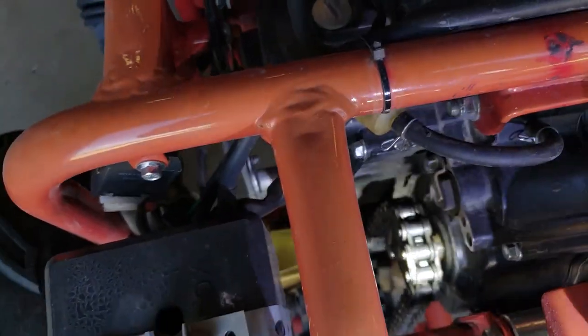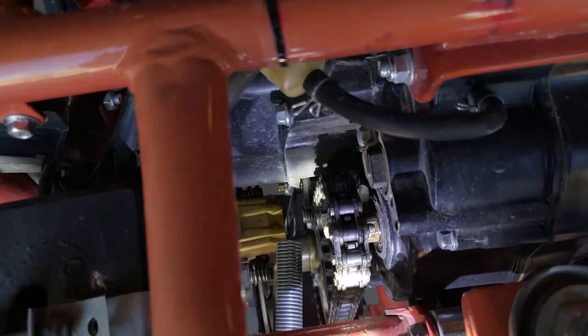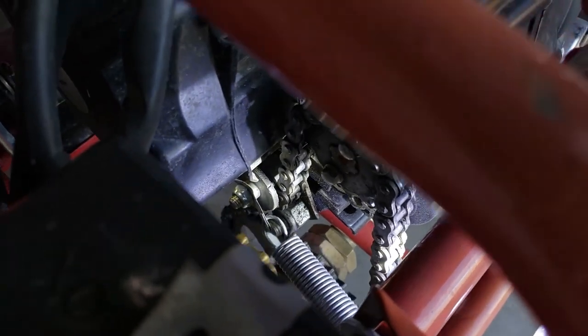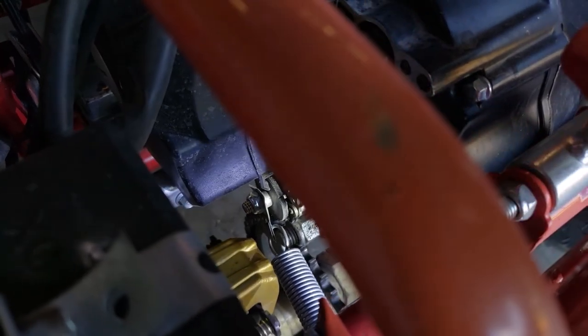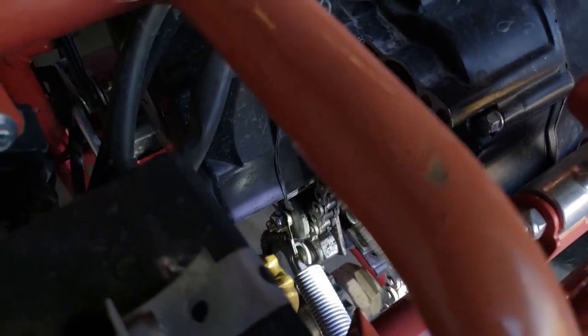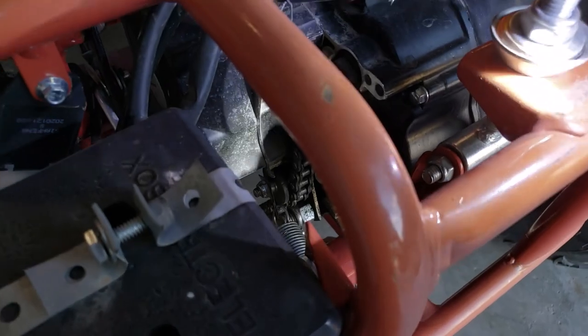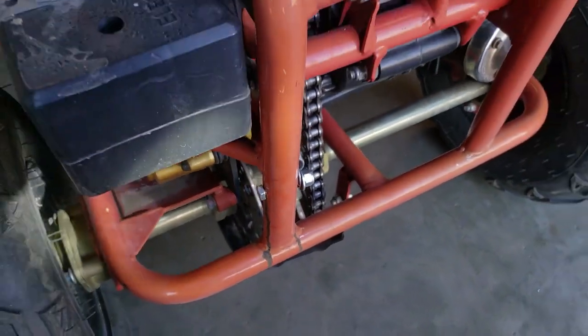It's hard to film in here. I originally had a really hard time finding anybody showing the setup of the chain tensioner on this go-kart — I guess it's really hard to film. You can see the idler is pressing in from the front on the chain, from the outside, and it's got a nice sidewall on each side so the chain can't come off the edge. We've only tested this for about 20 minutes of riding after I installed it, so we're going to test it again today. My son will bring it back and we'll make sure it's all still good, then lube it up and return it to the customer.